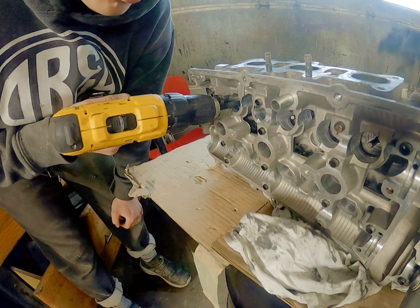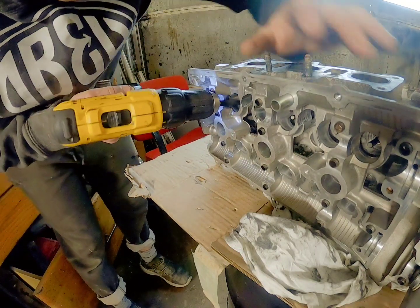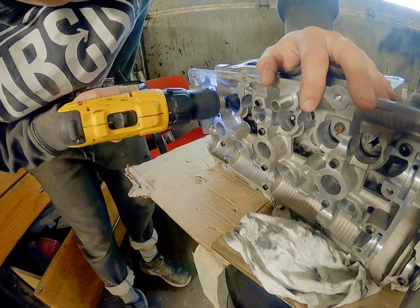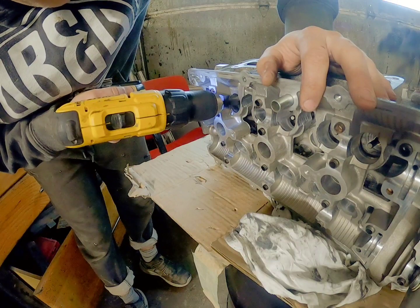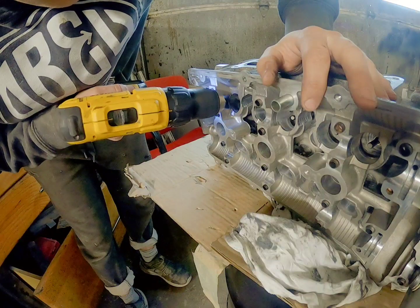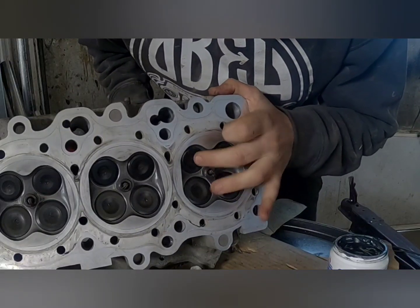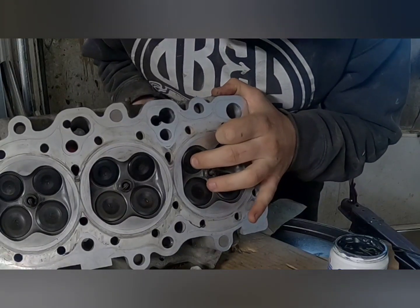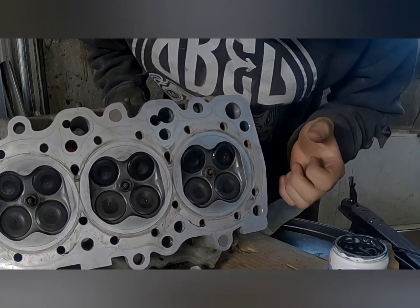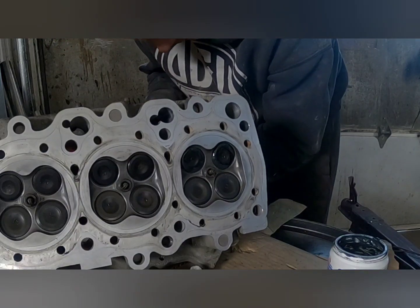It's all about how it looks — if it's all smooth and there's no pitting, you're good to go. This is what I'm doing with my finger — just holding it in while I actually get the vacuum line onto the stem. Now I'm just turning it by hand. Get the drill out, get it onto the drill, and then start lapping.